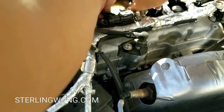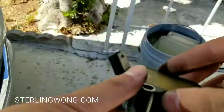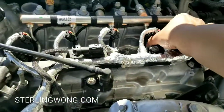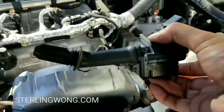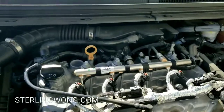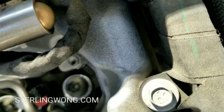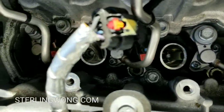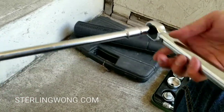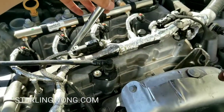To take out the coil packs, pull straight up. These coil packs are angled, which threw me off at first — I thought I needed an angled socket tool, but you really don't. The whole engine is at an angle, so you can use a straight extender and just pull the coil pack out. There's a lot of suction keeping them in, so wiggle while pulling straight up. All four go at a slight angle but come out well with a little wiggle.